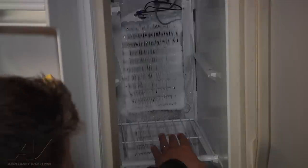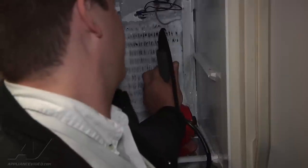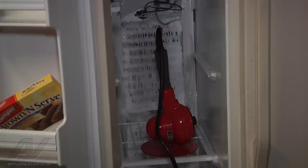So what I'm going to do is throw out the ice and replace the heater. Right now we have to go ahead and thaw out the evaporator so we can replace the heater and so it will function properly once we do. I'm going to use my heat gun to make my life easier. I put the rack back in and make sure there's nothing plastic on the back side that the heat gun may melt, then get the heat gun in position, turn it on, and let it sit there so it'll thaw out. You'll want to watch the heat gun so it doesn't melt the plastic liner.